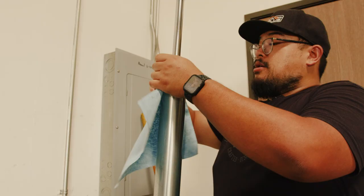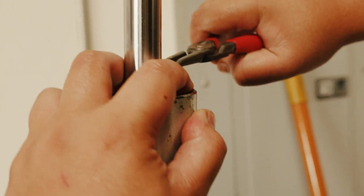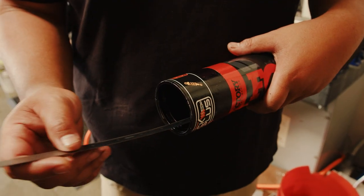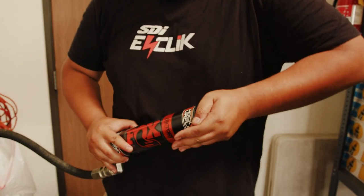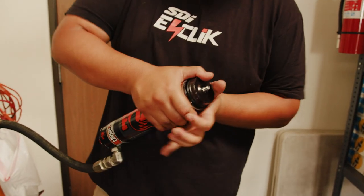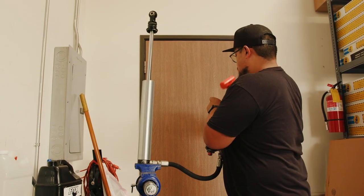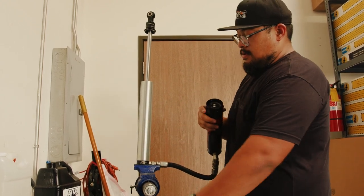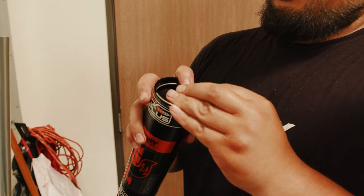Slide that seal head down past your groove, clean off any excess fluid, and then take your snap ring pliers and pop the snap ring back into its home. Get a ruler, check the IFP depth to make sure that's in spec. Then take your reservoir end cap, press that in past the groove, and slide the circlip in place.